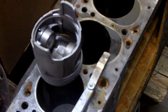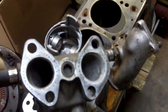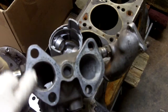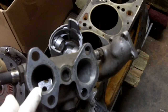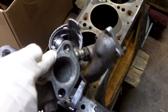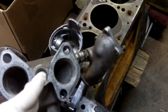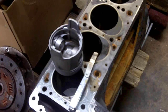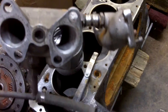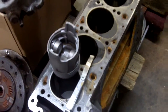Another thing I see fairly frequently is on the intake manifold for the 190SL. These rubber gaskets have a tendency to collapse with age, or if you use the wrong gaskets and don't use the factory gaskets. For some reason people think that indenting all around here with a punch is going to help keep the gasket from migrating — and it won't. It just gives you something to do with a punch in your spare time, and it doesn't do a thing for holding the gasket in place.